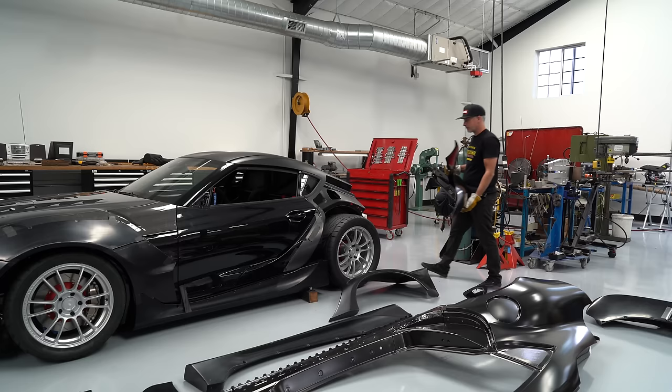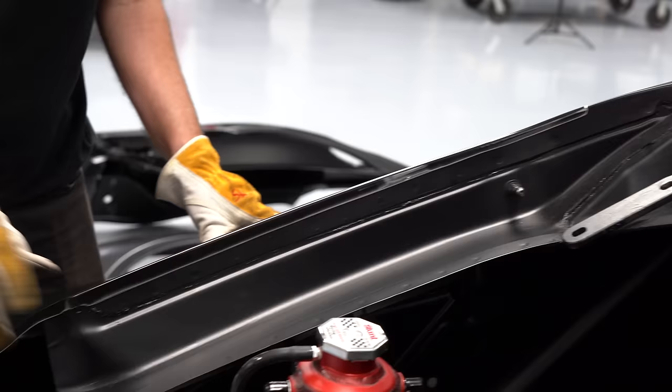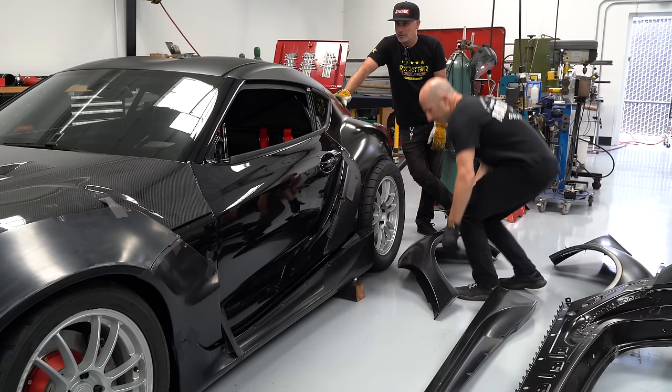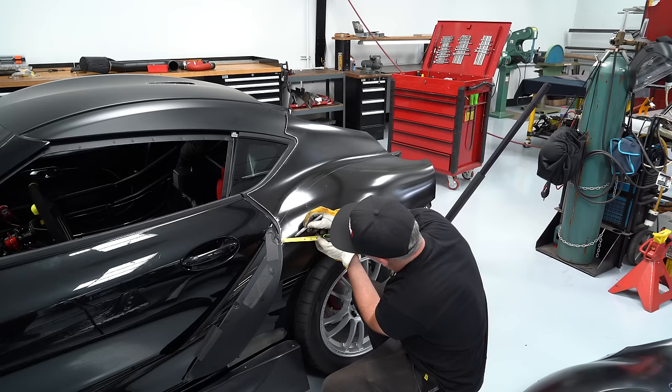Once Sean cut just the part that we wanted out of the side of the car, we set it on there and tried to figure out exactly how we were going to mount it. What we decided was to keep the top lip that wraps around the c-pillar on the car. That way it located it relatively well and it had something to hold it up. You can see how that whole back corner is replaceable — we can replace the fiberglass over fender and also replace relatively easily the rear quarter panel.